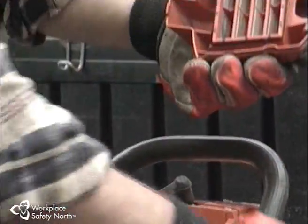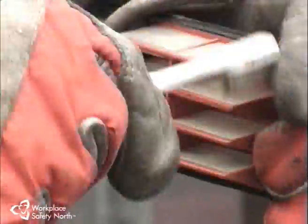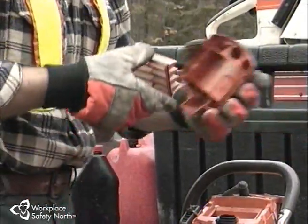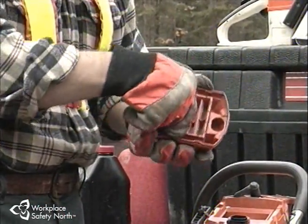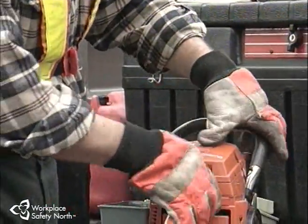A clean air filter and unobstructed air intake are two of the keys to smooth engine performance. The air filter should always be checked first when engine performance decreases. Clean the filter regularly by blowing it out, by shaking it, or by washing it with a small brush in soapy water. Be sure that you don't knock or blow dirt directly into the carburetor while cleaning the filter. It is a good idea to close the choke to keep all dirt out.